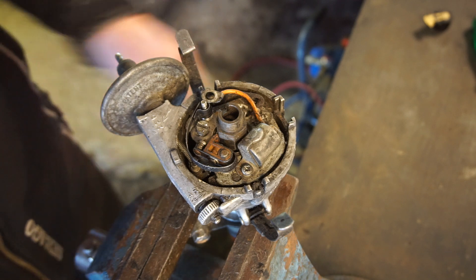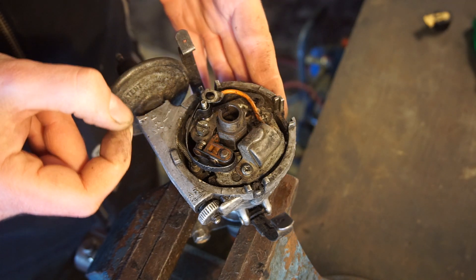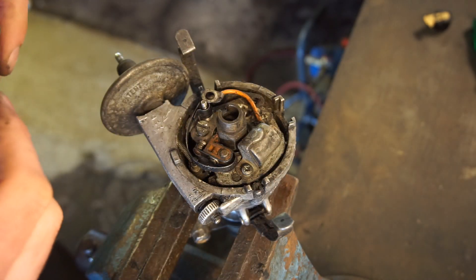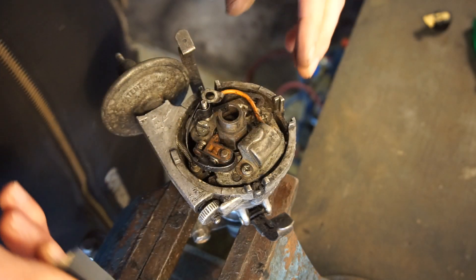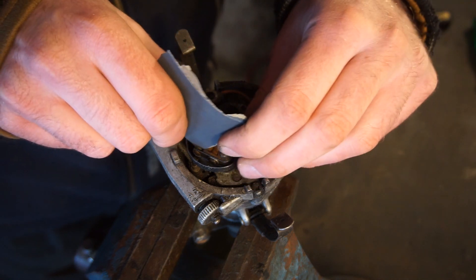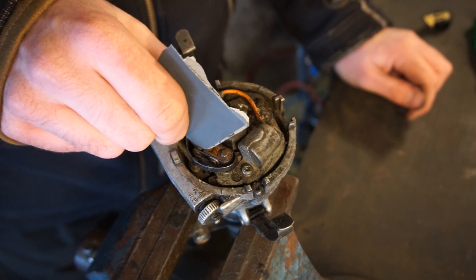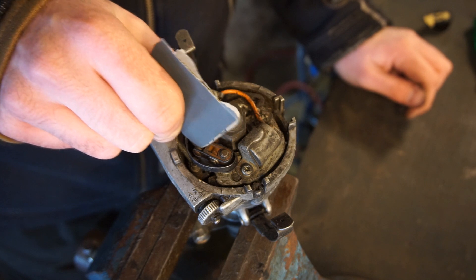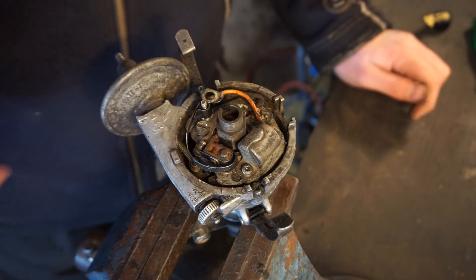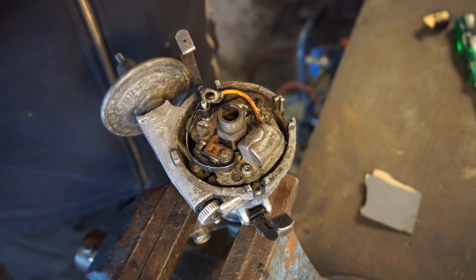Cleaning them is really quite simple as well. I usually recommend just to replace them if they're dirty. However if you want to clean them in the car, it's very, very simple. Grab a piece of very, very fine sandpaper or emery cloth. Fold it up so you get two sides to it, get it on a lobe, try and force it between the points, and basically just move it back and forth and clean it up. So this would be the easy way to clean them up if you're stuck on the side of the road - they just don't want to make contact, they're dirty, you want to get home. Clean them up like this - also if you're using a business card, if you don't have feeler gauges with you, usually just running that back and forth will be enough to clean them up.